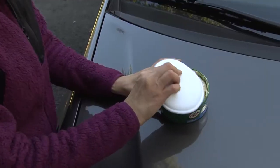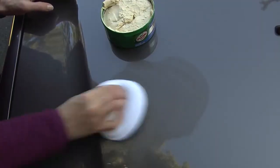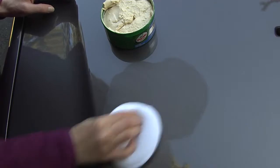Whether it's a paste or a liquid, use only a small amount, applying a thin coat. It adheres better, and too much wax leaves a buildup that's harder to remove. When it dries to a haze, start buffing to take off the wax using a clean microfiber towel.